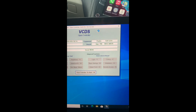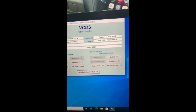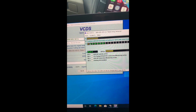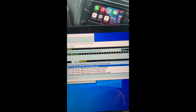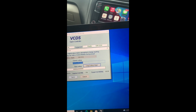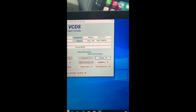The reason for the fault codes is that I didn't properly address the treble speaker management system shown earlier. I'll go to the stereo control module, then coding, then long coding helper, and scroll down to the bit for treble speaker monitoring. The module was showing as not coded. After closing and comparing the old and new codes, the new coding is accepted.